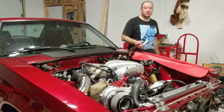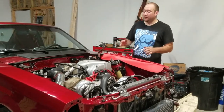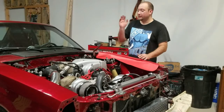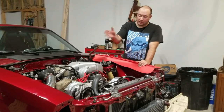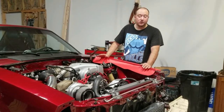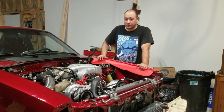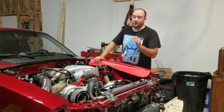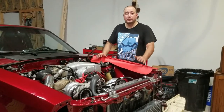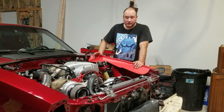That's going to pretty much do it for now. We got the whole new ECU kit plugged into the car, all the wiring is done, we cycled through and saw the wideband calibration, and we checked and verified there are no fuel leaks, which is a good thing. The only thing left to do is get it tuned — my buddy will be coming over next weekend to do that. We're going to leave the front bumper and hood off for now and take the car off the jack stands to verify for any leaks before first startup. Stay tuned for the next video.